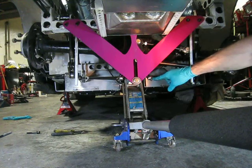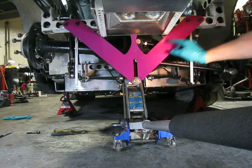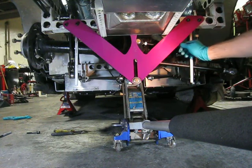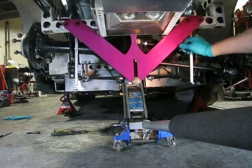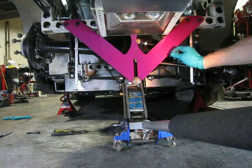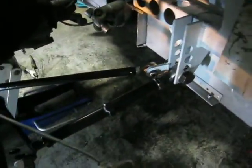These forward rods provide some stiffness to this crossmember here, because this actually isn't very thick steel. I could have made it out of really thick steel to give it the stiffness it needed, but I decided to make it out of thinner steel and then use these forward struts. You can see those and they bolt up front.